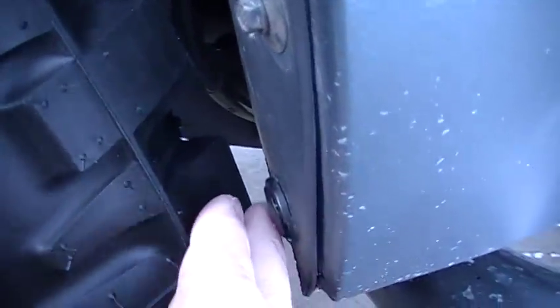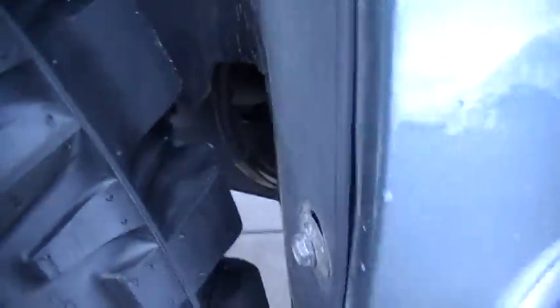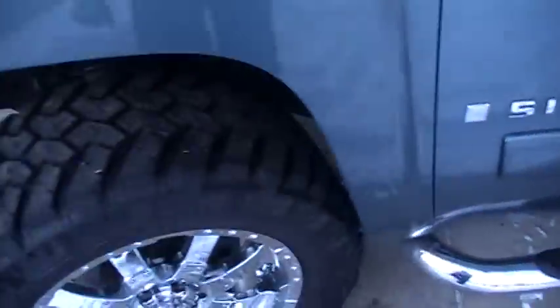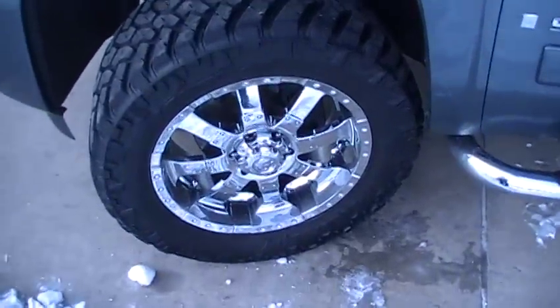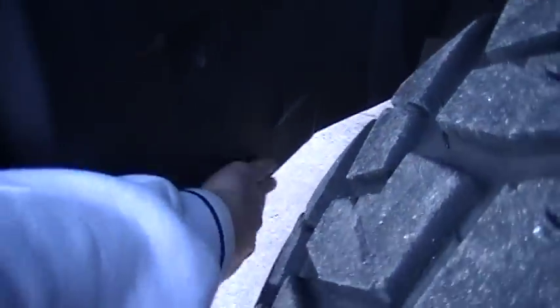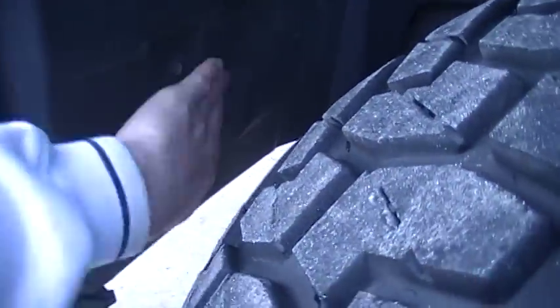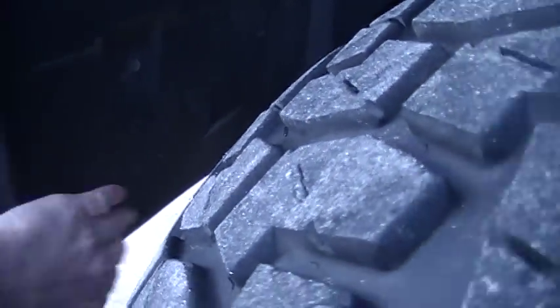It clears — it's a tight fit but it clears. I've driven it about 200 miles now and no rubbing at all, none that I can hear. It may rub a little bit on this front plastic, but if you heat it up with a heat gun and tuck it under so there's no straight edge sticking down, it'll allow the wheel to rub there without making any noise.